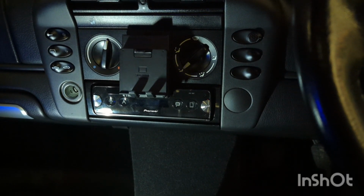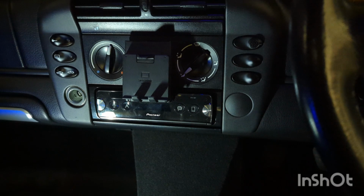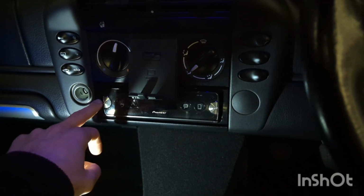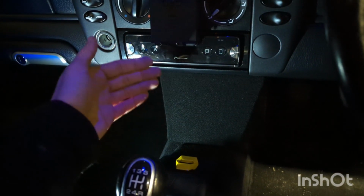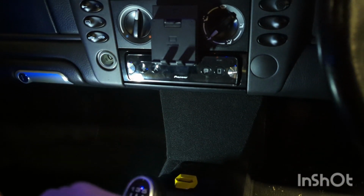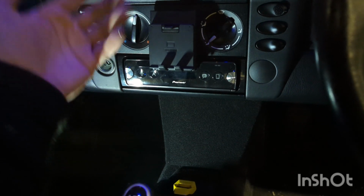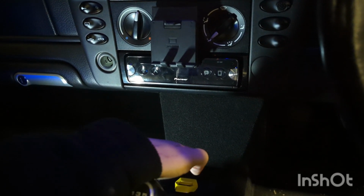And another thing to note, which was a suggestion from Tom, thanks Tom, to include in this video, is that some of these controls are effectively modular and can be moved around. Now in a standard car, you wouldn't have this panel here, you would have the other two options, which would include possibly a cubby hole, CD tray, as I've said. However, if you've got the electronic controls and you had like your air conditioning control here, you can simply put it forwards, unplug it, move that plug further down, and then have them lower down if you should want to.